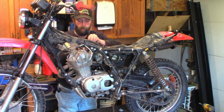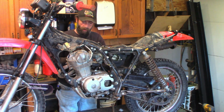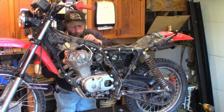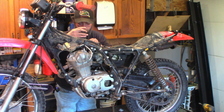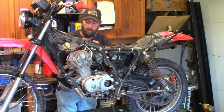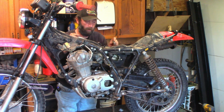It's hard to determine the tension on the feeler blade when it's bent on an angle like that, because you want just like a slip fit. It wants to be just tension on it. That's not enough because it slid right in there too easy. Okay, so it's just snug. I'll leave the feeler blade in. I'm going to snug the adjusting nut or the locking nut down. Oh, it's a little too much tension.